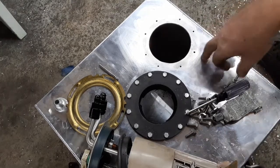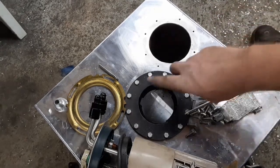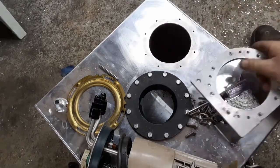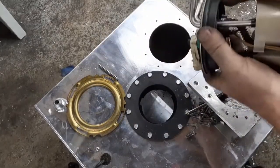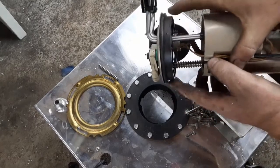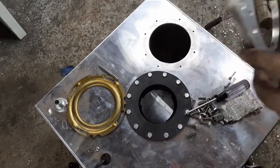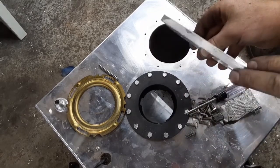Here's the fuel cell I'm going to be using — a cheap 10-gallon aluminum fuel cell off eBay. It just comes with the fill hole, so what I did was add a hole over here. This is four inches in diameter; it matches the gasket for a stock fuel sending unit. This outer diameter right here is also four inches. So what I did was make this plate, which basically just beefs it up — it's three-eighths inch thick.